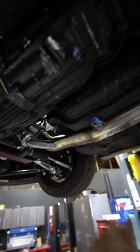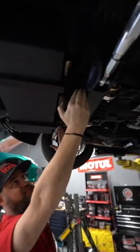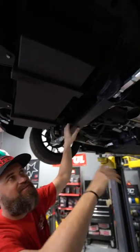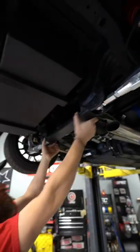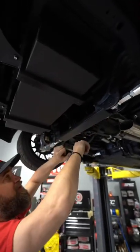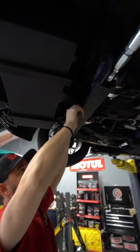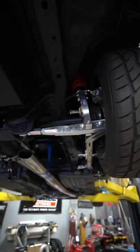Here is a little bit of insight from the owner, Mickey, on how the swap was done. We basically chopped out the whole Civic center section of the rear subframe — it's called a subframe, but it's not necessarily a subframe because it's welded to the chassis. We chopped that out, reinforced it with rectangle steel, and put it upright up here to capture the diff. So the diff is hard-mounted. The S1 — this is the rear portion of their all-wheel drive kit, which is pretty cool.